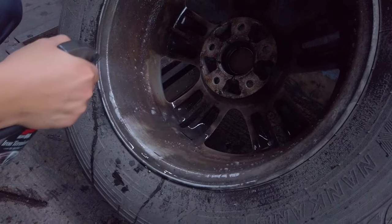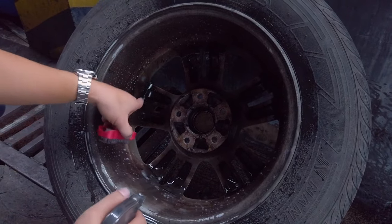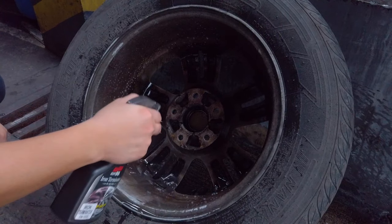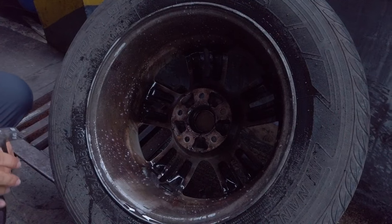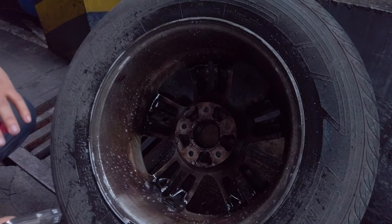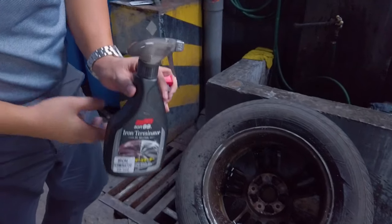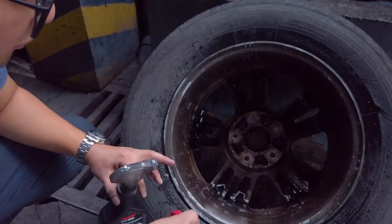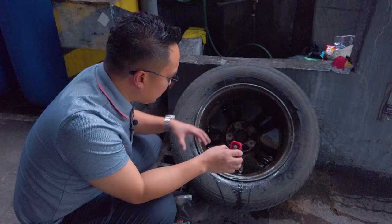So you take a couple sprays — we'll do it on the inside portion of the rims. You can also do the outside. Let it sit for a few minutes and what you'll see happen is the rim is essentially going to bleed out. What that bleeding is, it's the chemical from the Soft 99 sort of dissolving any of the iron deposits, any of the asphalt, any of the brake dust.